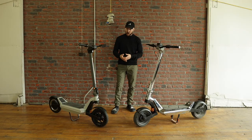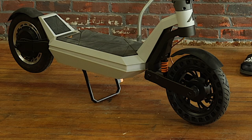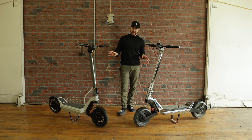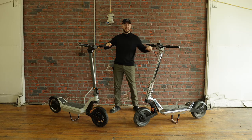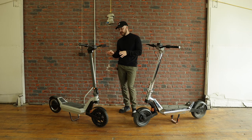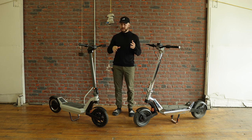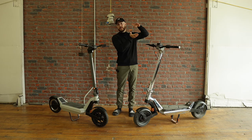The kickstand is different on every model as well. The main difference between V1 and V6: there's no rubber on the V1, so it's metal directly on the floor, which was damaging floors. Also, the V1 only had one knob on the left side, while the V6 has two knobs so you can deploy the kickstand from either side. The spring system on the V6 is way stronger and will last much longer. On the V1 it was rattling on every bump, but the rubber and tighter spring on V6 fix that completely.